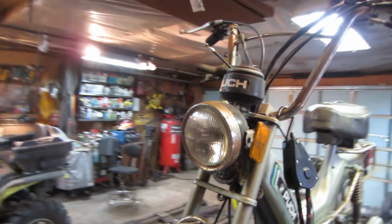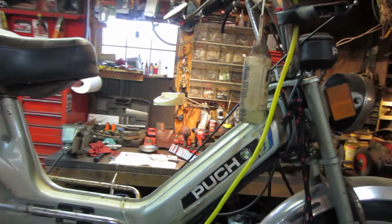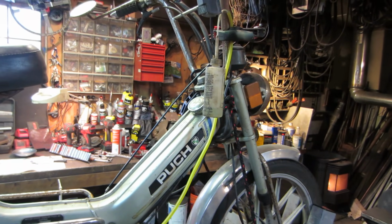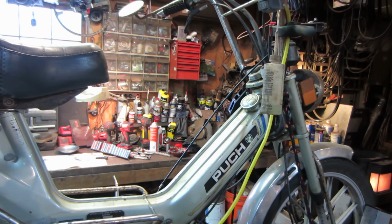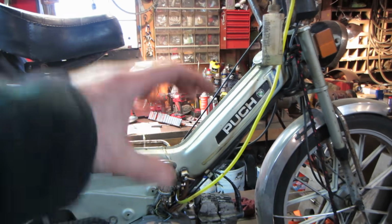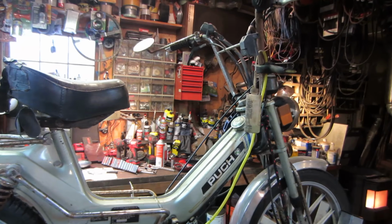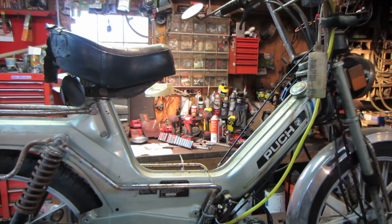What we have to work on is all the incidentals that are attached to it, and probably the next thing we're going to look into is that fuel tank. Unfortunately, the fuel tank is part of the frame, so I know it's really cruddy, but we may not have much of a choice. With a regular gas tank, you fill it with acid and squish it around, roll it in all different directions, empty it out and rinse it out, and you can kind of coat it. Well, it's a little harder to do when it's on the bike. So I figured we'll take the cap off, take the petcock out, look in from the bottom, see what kind of crap we get out of it, and see what kind of shape it's in.